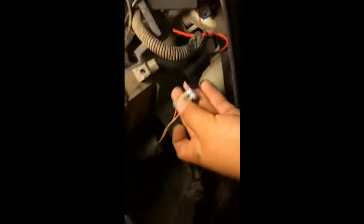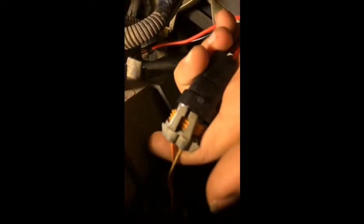When you take these two wires and try and match them up, which I'm trying to do one-handed here because my cameraman decided to run off, you notice orange is power, you follow it across, and it goes to black, which is not power. The company that made this actually wired the H.I.D box itself backwards. The jumper cable is backwards. Most people would give up at this point.